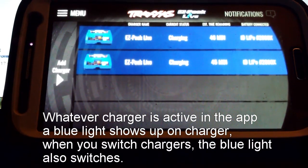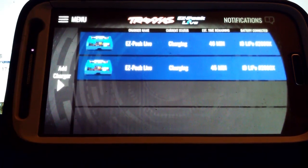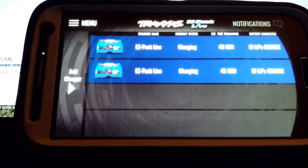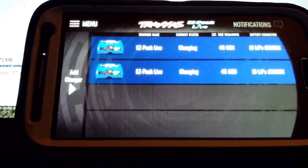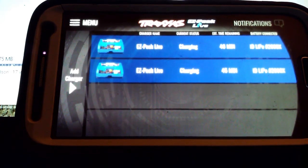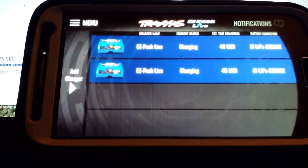Anyway guys, thanks for watching my video, I hope you find it useful. I'm on my third charge right now of my Traxxas 6700s 4-cell. They recommended that you do five runs on the batteries without going full throttle, staying at about 70% power. So this is going to be the third pack that I'll run at 75% power, and then I'll have two more runs to really prime the LiPos and get them at their best performance and life.